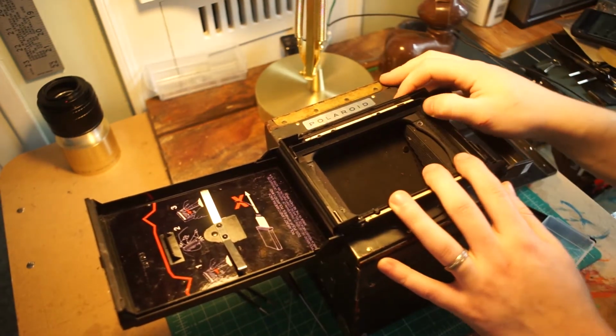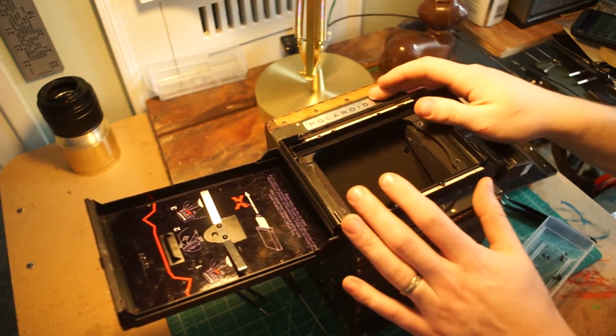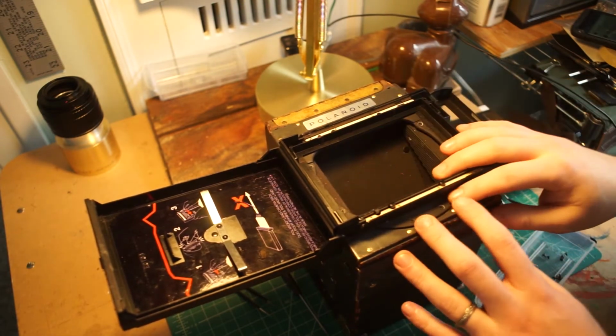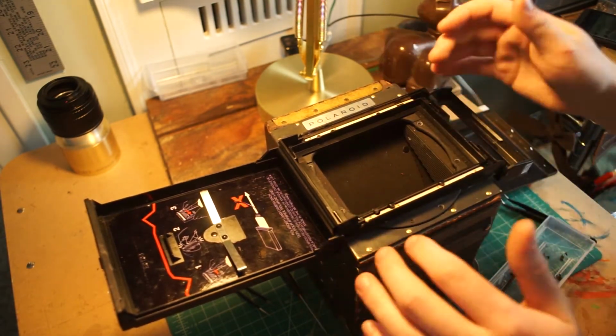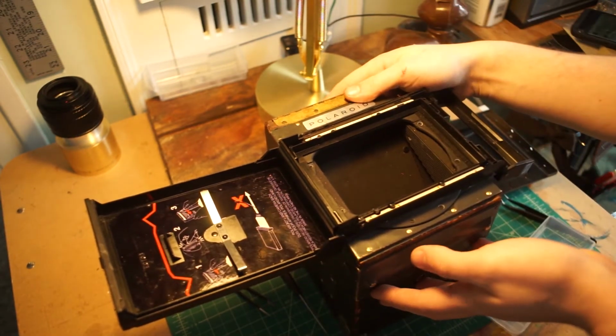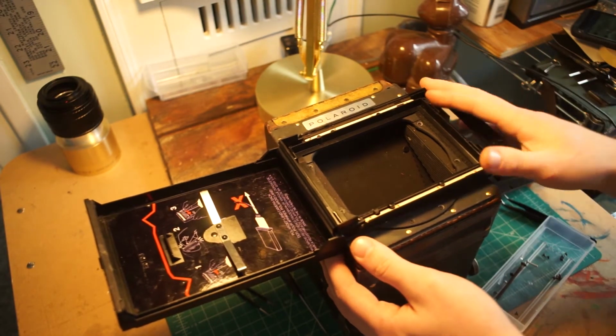Alright, our CB103 adapter is on the camera, and I'm going to take the rest of the back apart just to show you the mechanics, but also, as an extra tip, if these screws were too hard to get in from this angle, sometimes you can remove this plate and then attach it and work with it off of the entire body of the camera. This is also tough because there are a couple screws that are a little hidden that you'd have to come at with an angle.